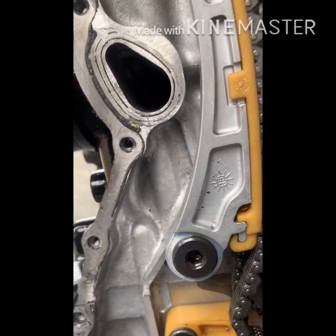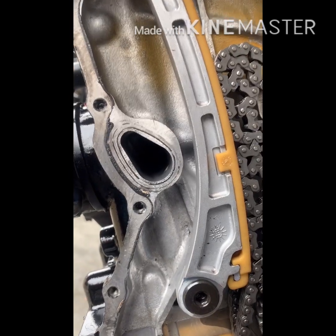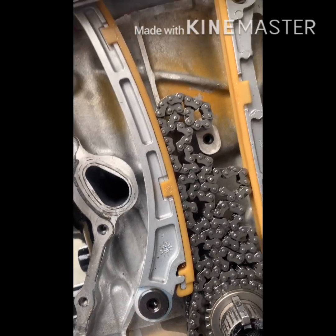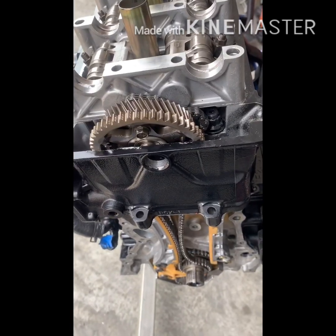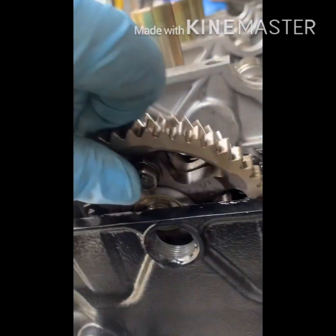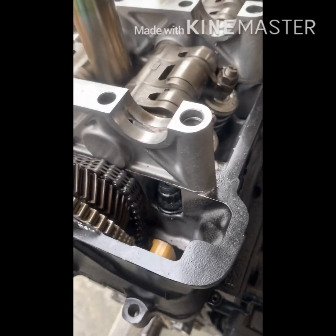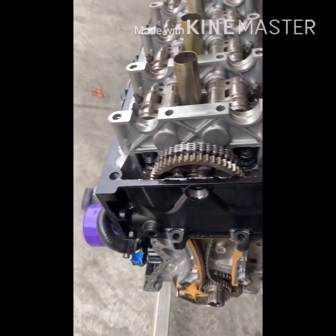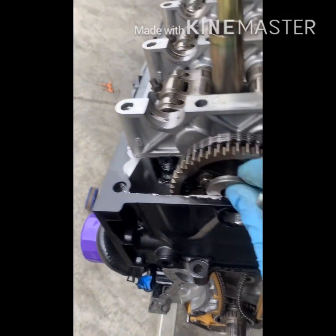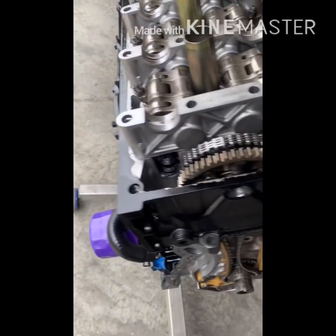Ninety bucks for my peace of mind — I'd say it's well worth it. I've already installed the timing chain, made sure it was still at top dead center. I'll verify it again before I put any of the gears up top in the head. The guides all look new — it was rebuilt about 5,000 miles ago but I don't trust people, so I wanted to verify it anyways. I'll also clean up all the RTV and make sure I get a good coat when I put mine on there. Getting the sprocket in here is the pain in the ass. I really don't have a foolproof method — with the chain behind it you can just move it down there, pinch it down, pull the chain up so it slides down. There's a washer that goes in the front after you get the timing chain on top.